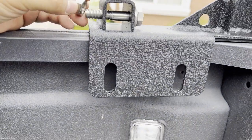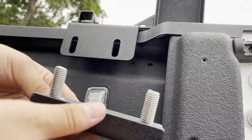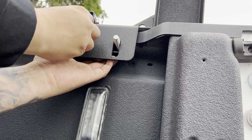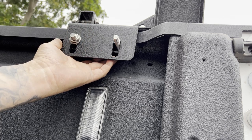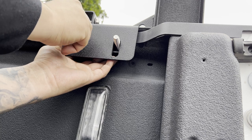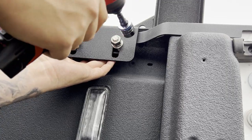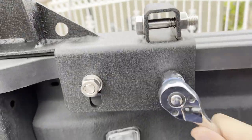This part of the rack is used for fishbone accessories and goes with this bolt, washer, and nut. For the actual bed mounts, this bracket goes on this mount here — you want to dip it under and over, making sure that top lip catches the lip of the bed. Then install the washer, lock washer, and nut. Do not forget to apply thread locker because I skipped it in this step and had to take it off and reapply it. After tightening with power tools, go ahead and tighten it manually hand tight.